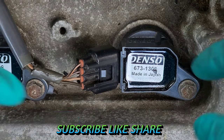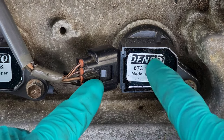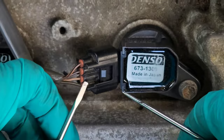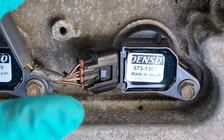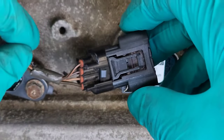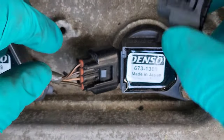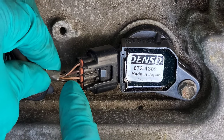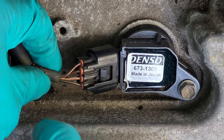I'm going to change the connector on these coil-on-plug connectors — it's not that difficult. You just need a small screwdriver or a pick. I went ahead and ordered a new connector, but I ordered two different styles and I'll show the other style in a second. At this point you want to take pictures of how the wires are arranged and the order they're in.